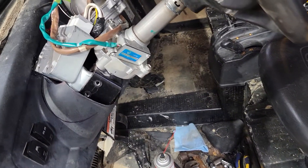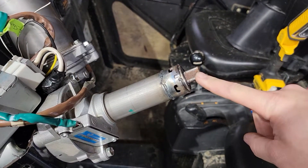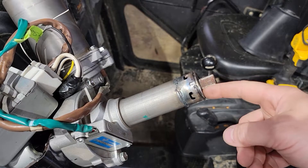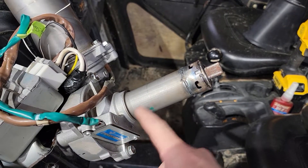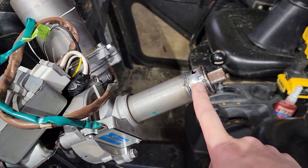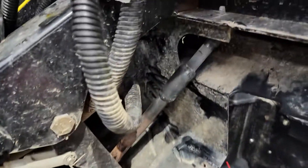There is a slight delay from turn-on but it seems to be okay. I had a friend help me cut down the shaft. This is the end of the steering shaft from the factory Cub Cadet. This is a bearing I got off Amazon that fits on there, and then I welded it into the steering shaft that's inside here, and then welded this piece from the Toyota steering column onto there. Works pretty well.